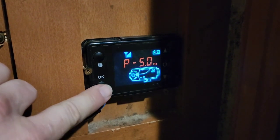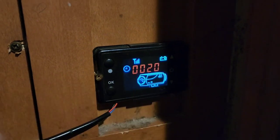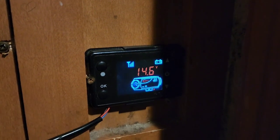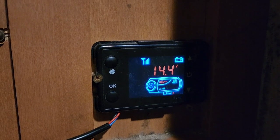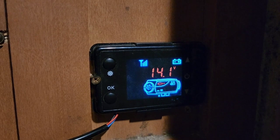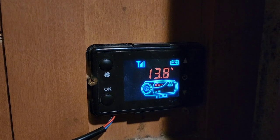Here on the heater control panel, you're going to see the voltage. If you press the OK button a couple times, you're going to see voltage. I'm going to turn it on and go back to the voltage reading — you're going to see as this voltage starts to sag. It started off at just below 15 volts, and you're going to watch this voltage sag all the way down to 12 volts because the glow plug is drawing a lot of power for the initial startup.